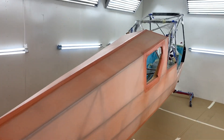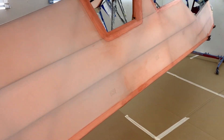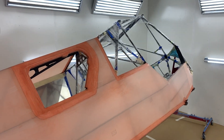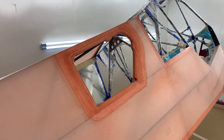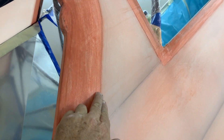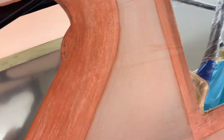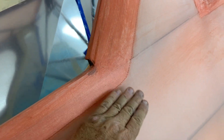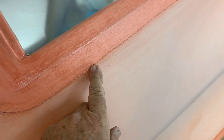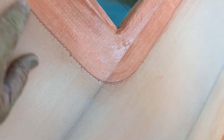Let's talk about what we've done here. This is the fuselage. I've already applied all the tapes on here. As I said in a previous video, one of the most important things is to get your edges ironed in. Every single coat of poly brush I put on this airplane, I always take the iron and go around these edges — smoothing them, nibbing the edges, nibbing the tapes. Every time you put a coat on, this edge could loosen up a little bit with the MEK.